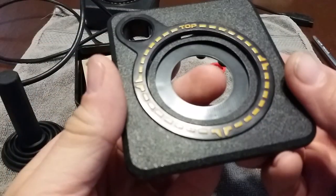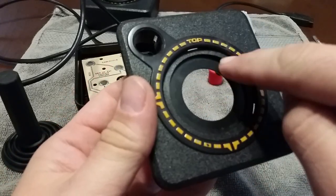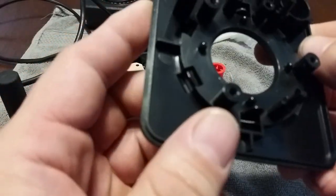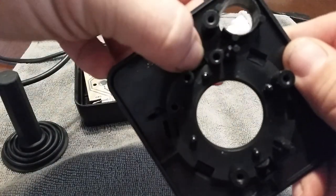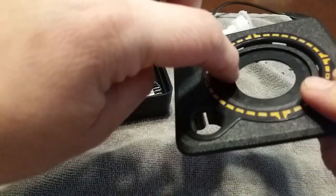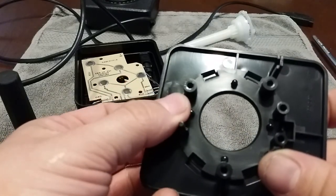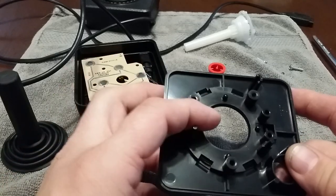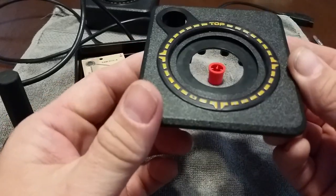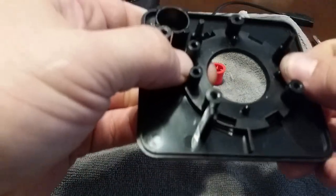On this particular joystick, there's a little ring around the edge. On the back side there are little tabs. You just kind of push it ever so slightly and you're pulling up that ring. Come down here and do the same thing — there's a little tab here. Don't be too rough with it; this is 40-year-old electronics, plastic and all. You want to make it so this little ring is recessed up at the top. Just keep doing it until you get it where you need it to be.